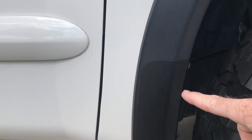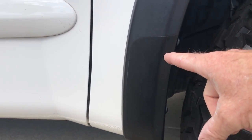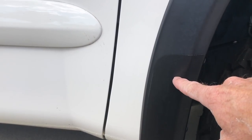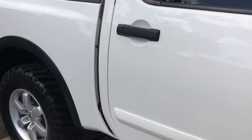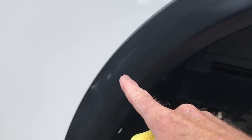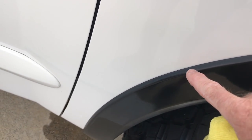Back to my cloth — rubbing this off now. Look at that shine compared to zero shine down here. You'll notice a line of demarcation: there was a fender flare bolted on right there, so this area was covered for most of the truck's life while this side was completely exposed. This side also sits in the sun more, so it has more problems. I started this side by hand and you can see some streaking — I'll come back with the buffer, then finesse this little lip by hand since the buffer can't reach it.